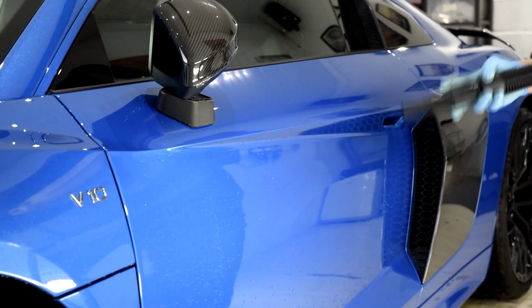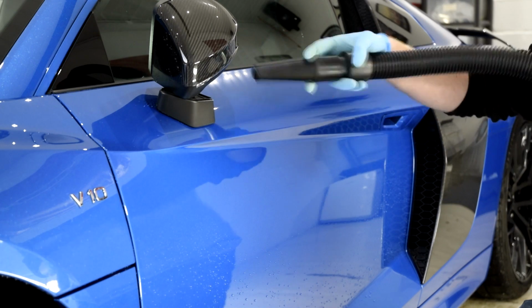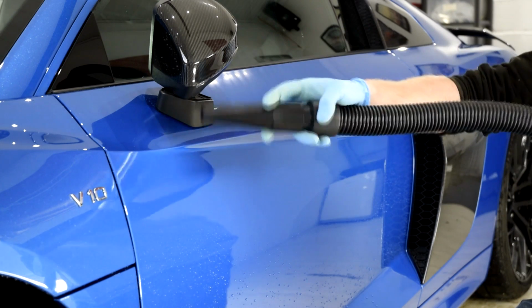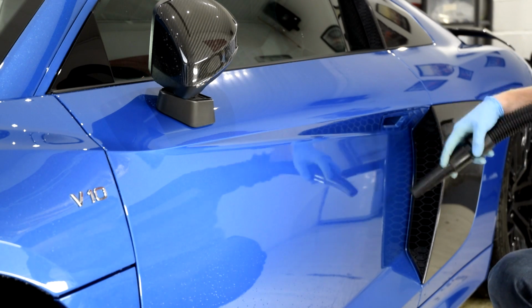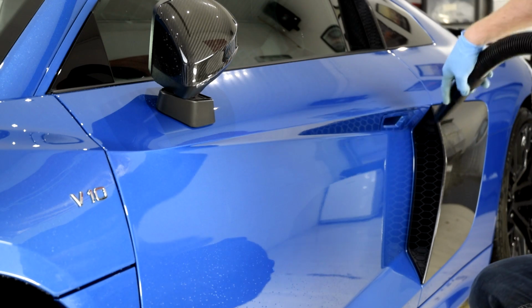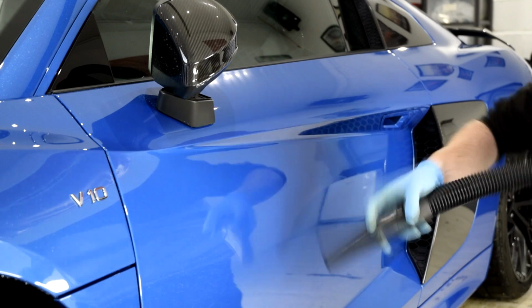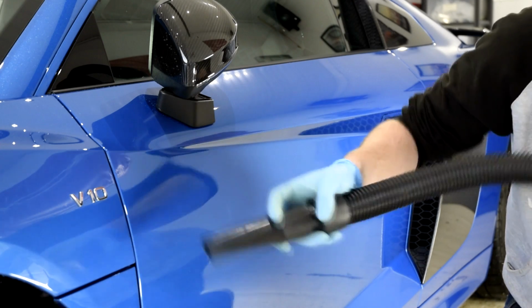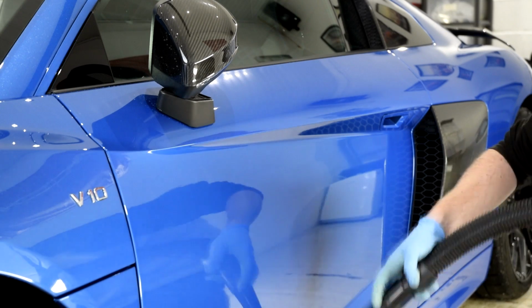The wet work of the R8 is complete, so it was turned around in the courtyard and brought inside the unit for drying and finishing. To minimise contact with the paintwork, and thanks to the super slick ceramic coating with the aid of Ceramic Boost, I opted to blow dry the entire exterior. The benefits of blow drying don't stop with reduced direct contact with the paintwork to avoid any potential marring caused by drying towels, but also so you can remove all the trapped water from the gaps and crevices.